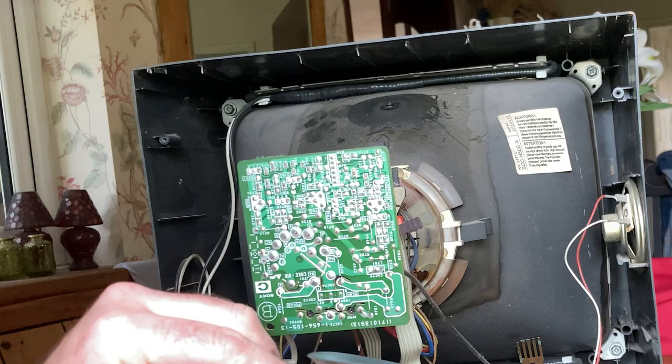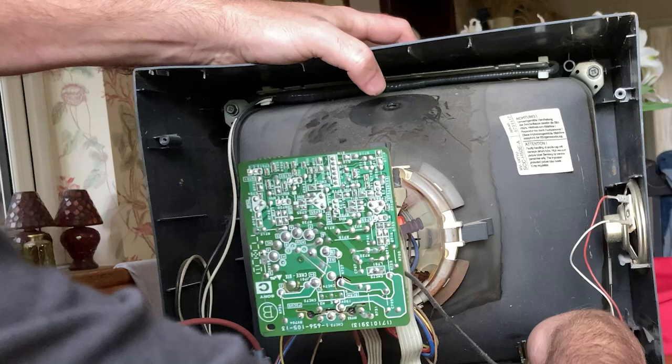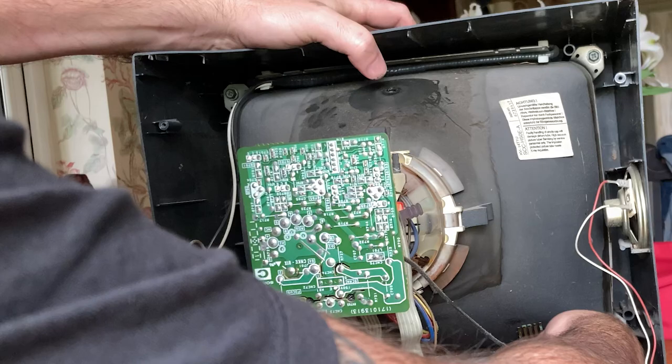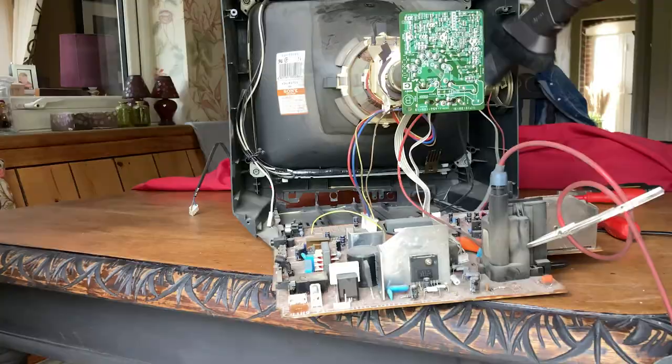Those little prongs are where the anode cable is — that's the one giving you the positive charge. If it's been left on, it will give a little arc as you touch it. Once that's discharged it's completely safe. Disconnect it and let it hang. Most of the charge sits on the board there, so once that's done the board is stable. Then disconnect all the cables and remove everything holding it to the chassis. The C-board here drives the deflection yokes and the RGB signal down to the tube — a very vital part, so don't mess around with it.